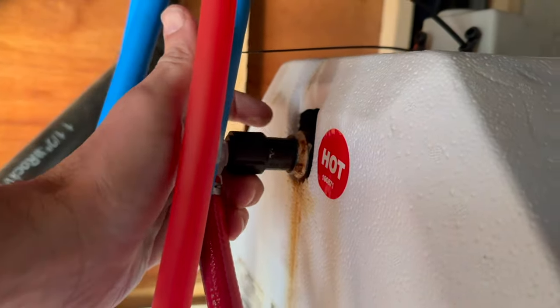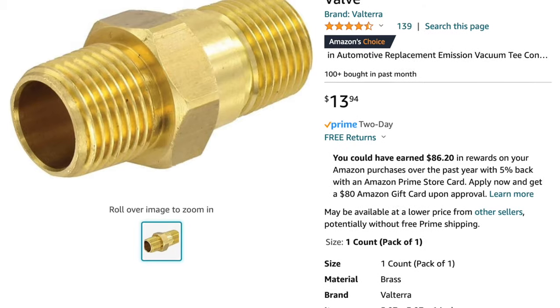If this problem is what I think it is, you basically have your hot water line coming out of the top of your water heater inside the basement. As it comes out of that water heater, there's going to be a little plastic or brass check valve, and that just keeps the water from flowing back into the water heater. We've had this camper for five or six years and it has a plastic little check valve. I've seen people online where these little plastic check valves tend to break sometimes with motion and things like that. I believe the little spring inside is now bound up and stuck in the closed position, so when you go to turn the hot water on, no water is flowing past there.